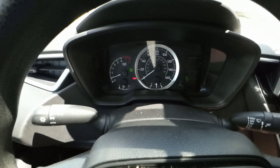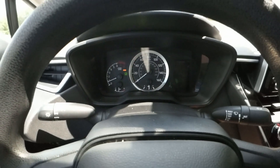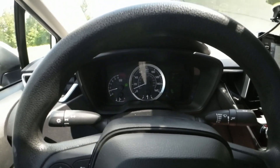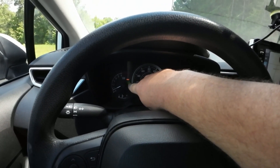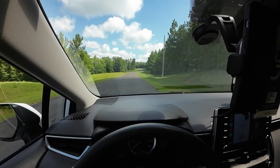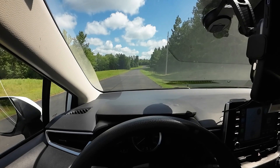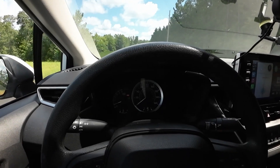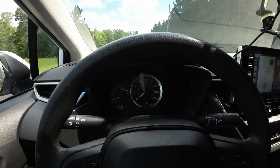There's a parking brake hold button behind the shifter — let me show you exactly what this does. I'll put the car in gear and drive just a little bit to demonstrate. When I come to a stop — say at a stop sign, a red light, or a drive-through — the second hold indicator comes on. When both hold indicators show up, you can safely take your foot off the brake and the car will stay exactly where it is; it won't creep or drift forward. It does have a time limit — it'll hold the car for three minutes and then release, but it will warn you ahead of time with a beep-beep-beep letting you know the time is about to expire.